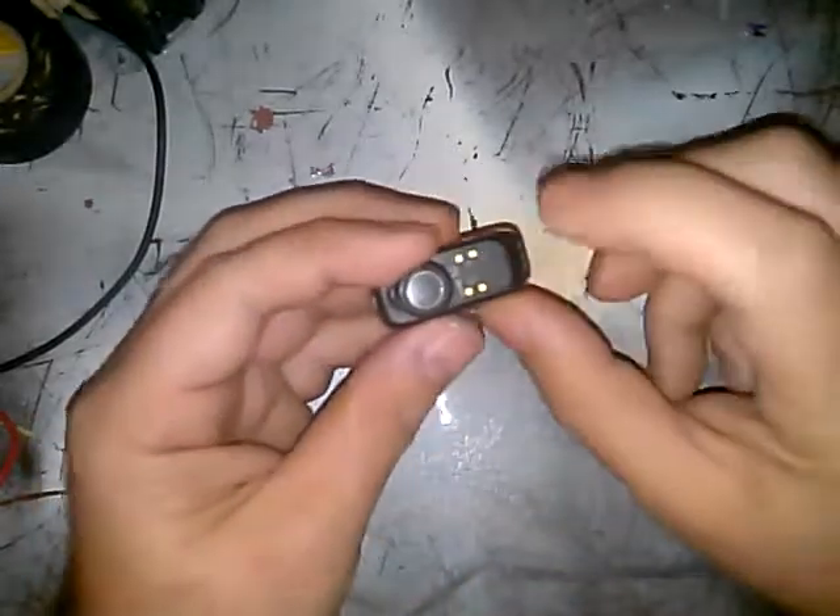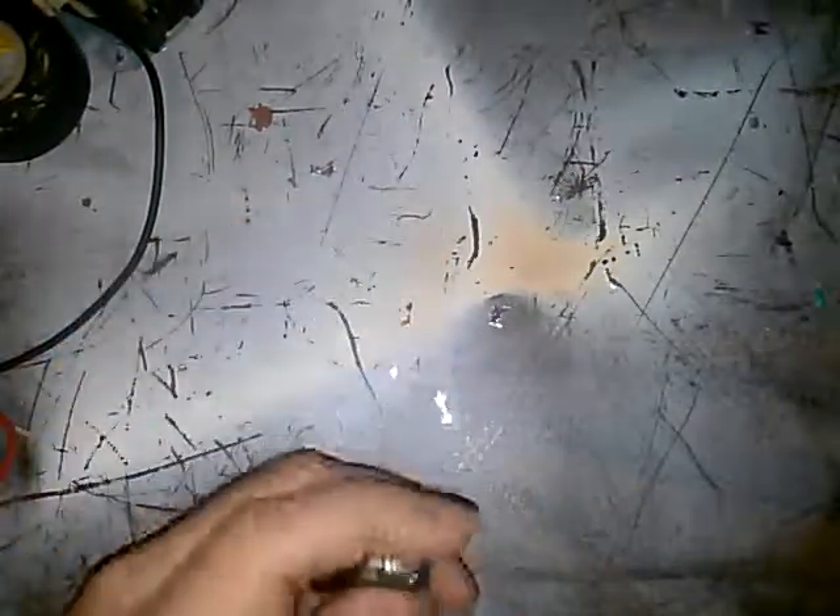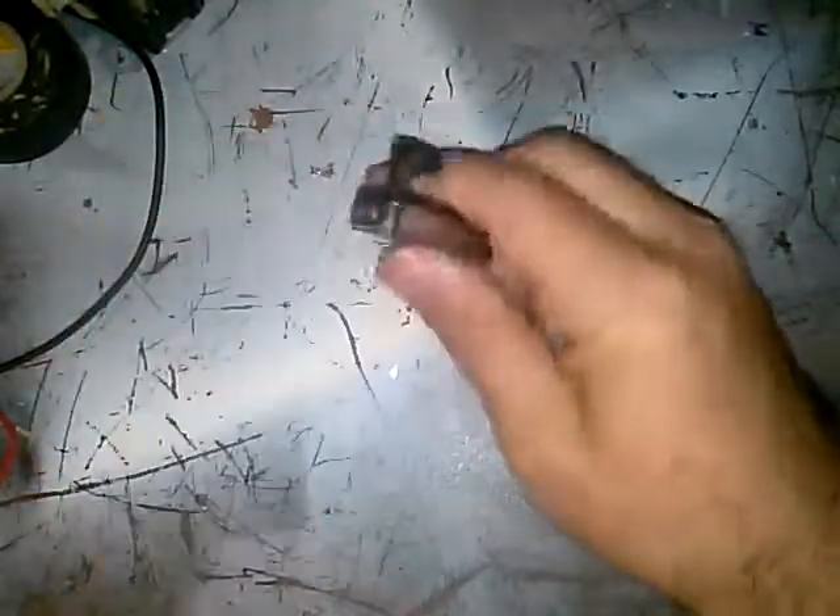I have a bunch of these and only use them in certain situations. We'll tear into it — there's going to be a lithium polymer battery in this pack, probably about 3.7 volts. There'll also be some charging circuits, LEDs, speaker, microphone, and the Bluetooth transceiver. You hold the button down, the phone sees it, you sync it up and it sends the bits across. The authentication is very similar to how Wi-Fi networks work with WPA.